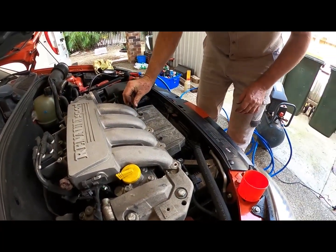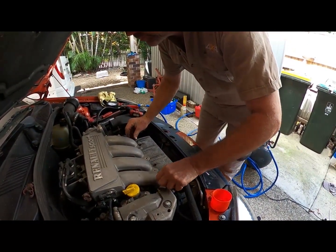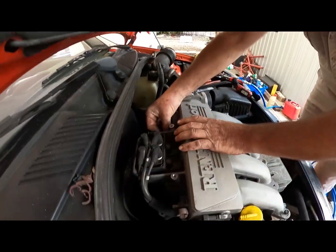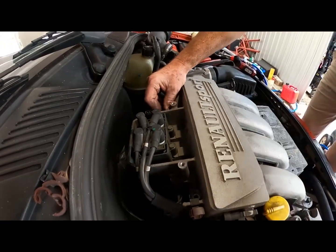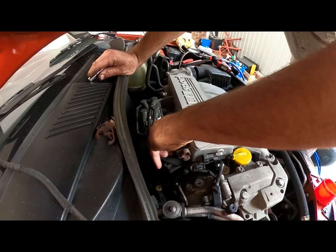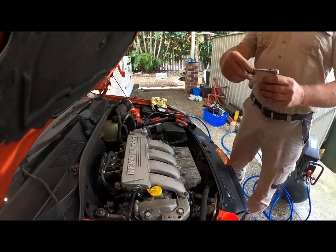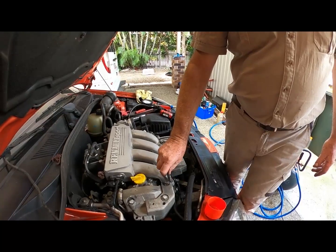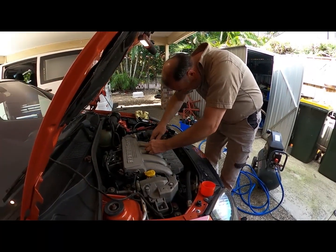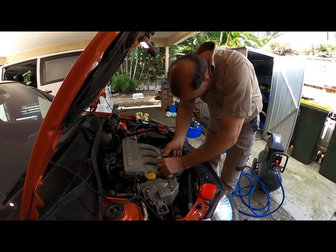So I always do an outside one. And they're all the same, these. And then these ones at the back, do them next before you get carried away with your front ones, because that might need to just come across a tiny fraction. Here's your other back one. So it's basically the four extremities on your manifold. You don't need a breaker bar to install these and tighten them. This has got a gasket under it, so the gasket will retain it. Don't need anything else.